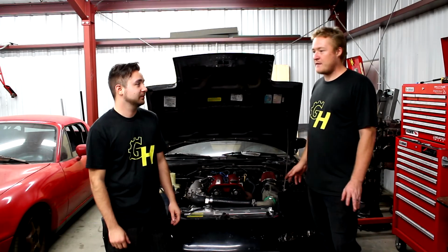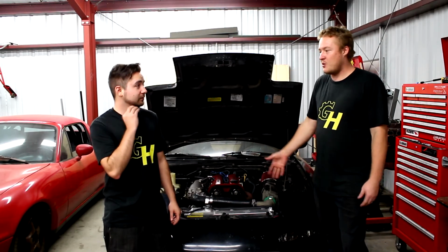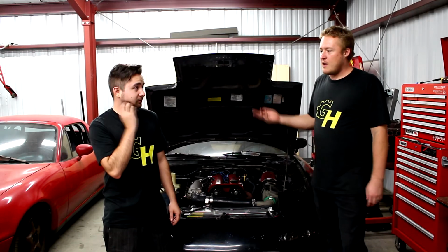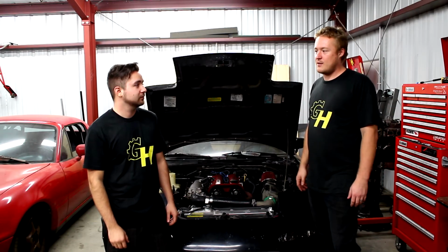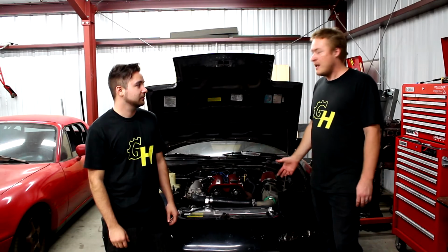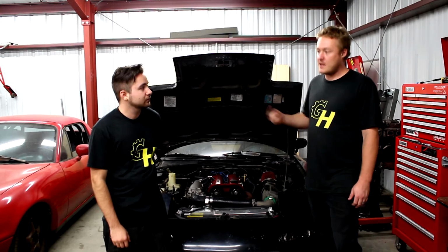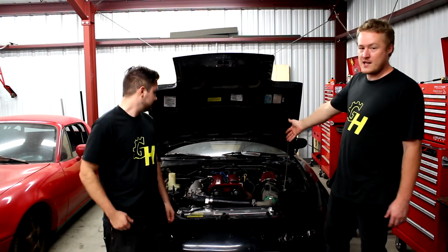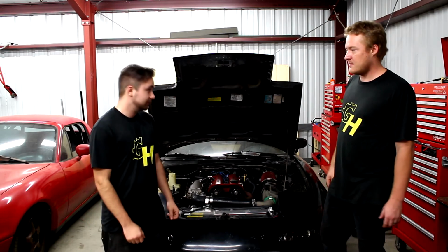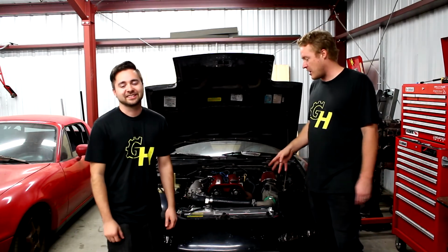Hold on though. We have the coolant reroute thing going on and this big huge radiator, and it's not hot out right now, so maybe it's not getting hot enough to turn the fans on. I don't know. I'm gonna have to test it more to see. I know the fans work from the fan switch, at least from the wiring. I grounded it out, I checked already, that works. But it's possible the fan switch we put in is, it should be working. I'm pretty dang sure that's not the issue, but the fans did not turn on yet.